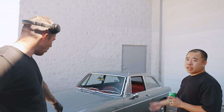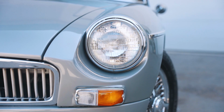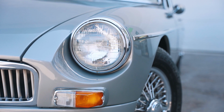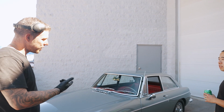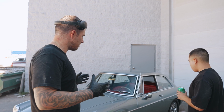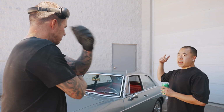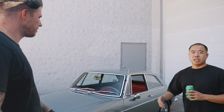This car ended up with new fenders, they're aftermarket, so Spencer had quite a bit of time just gapping the door to the fender with a finish in metal. Bondo, shaving it, welding it, testing it, and repeat. On off, on off, that was like a couple weeks. The thing with these cars is there's not a lot of adjustment in them. Everything has to fit quite tight and perfect. There's not a lot of movement in these panels. And we had to factor in all the paint buildup and thicknesses on the edges.